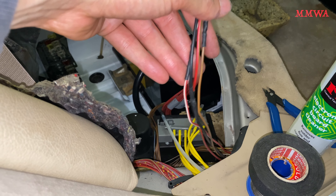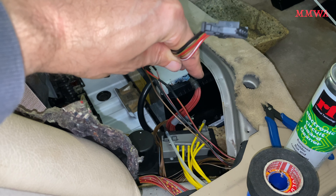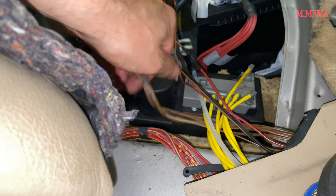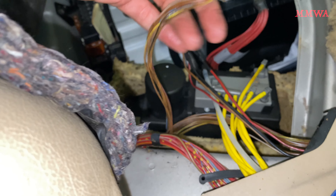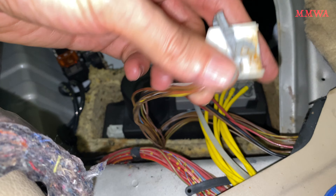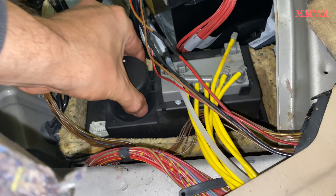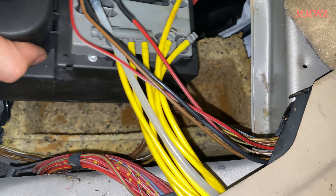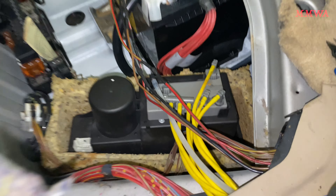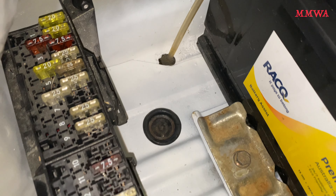This was the nasty surprise that awaited me after removing the back seat in my 210 project that I just took possession of. The reason I went looking back here is because of the brown stains in the carpet behind the driver's seat. Sure enough, water had flooded into the vehicle — either from driving through a puddle or from standing water — through the hole for the vent tube for the battery, because it has a poorly fitting grommet that is obviously not correct for the 210.